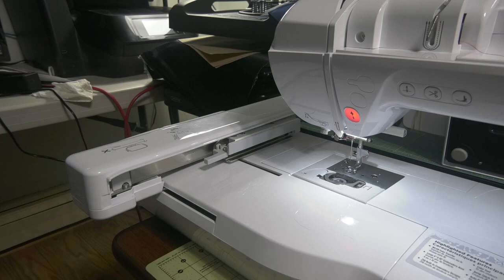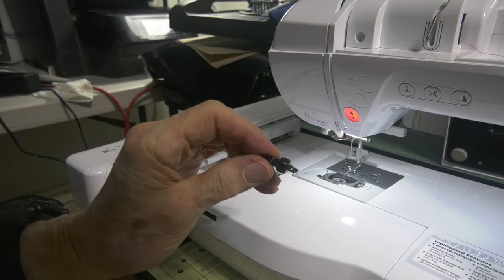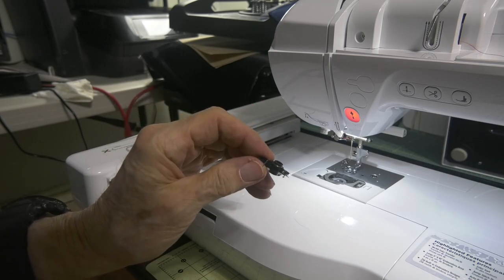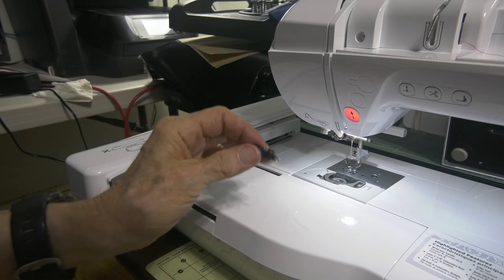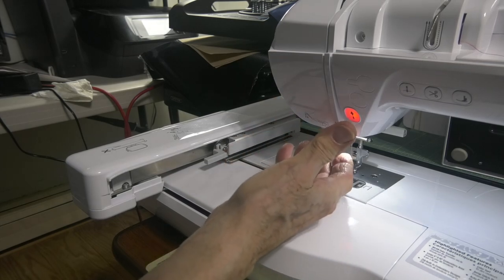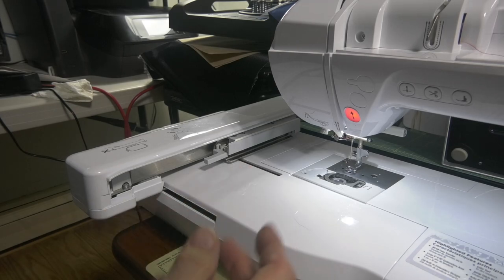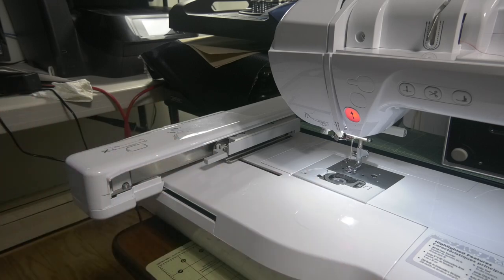I made a video of the defects. Here's the old one I took off — I replaced it with one of three that I bought in 2013 for my PE-770, and they're the same, which is unbelievable. Well, this portion is different — they upgraded it. The auto threader has what they call a C-clip; it goes around the shaft and keeps the whole unit from dropping off. I took it apart, took pictures of the pieces, put it back together, and put it back into the machine.